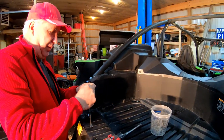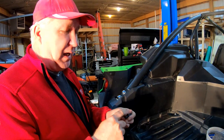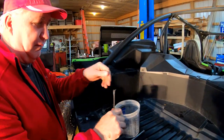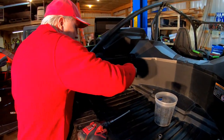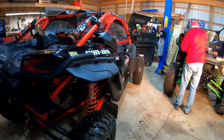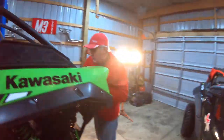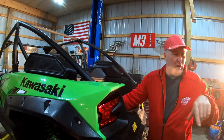Anybody who's taken plastic rivets out knows how much of a pain they are. A tip from years of doing this automotive style: spray them with WD-40 before you put them in — they go in a thousand times better. They'll also come back out easier. Always keep a little parts bucket around so you don't lose them. He'll put some WD-40 in a paint sprayer, clean the machine, and spray all the wheel wells and A-arms with a nice misting, then just let it dry without re-wiping.